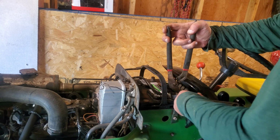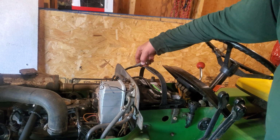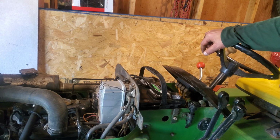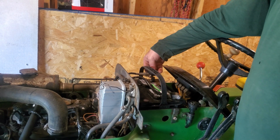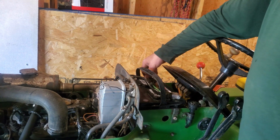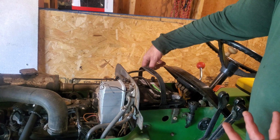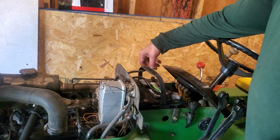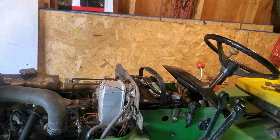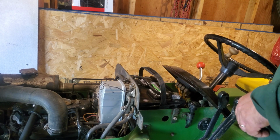Well, that's getting pretty tight. Now, one thing I'm going to check for here. Like I said, I don't know if the battery was just weak or what, but I don't think anything's dragging it down. What I'm going to check is when I retouch the negative here, if there's already a circuit closed somewhere, I might get some sparks, possibly. And that would be a hint of some kind of phantom power drain. I'm not seeing anything there, so maybe that battery was just weak. And of course, there is a possibility that maybe the generator or alternator was not working that great either.